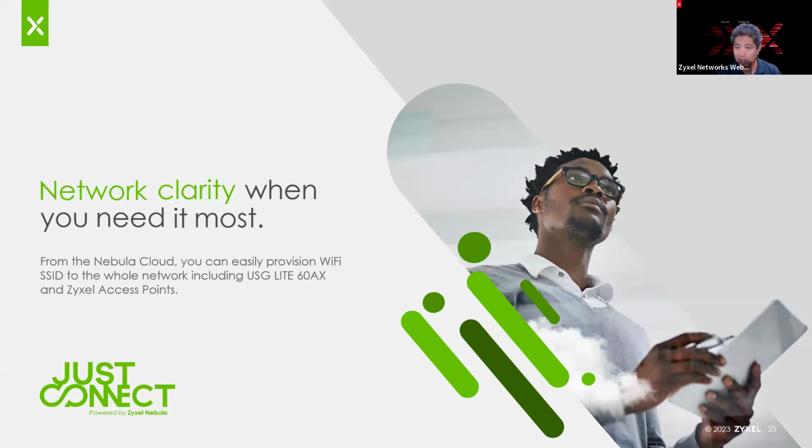Rusty does ask, using your coffee shop example, is it easy to segregate public access use from internal business device data? Yes. So you can create multiple separated networks like you would do on a typical router. So you should be able to have a guest network that's VLANed out as well as business, for your POS. You can do multiple different ones as well.